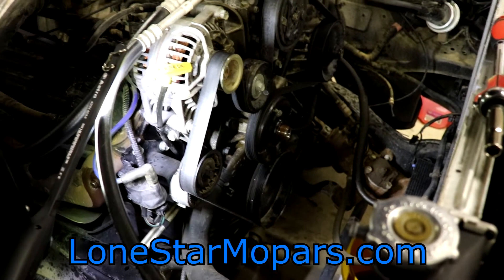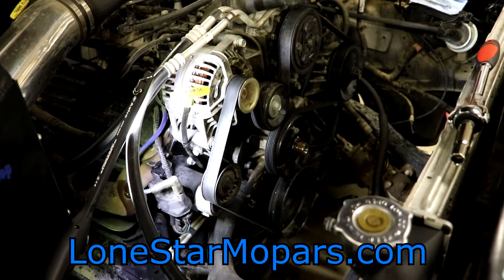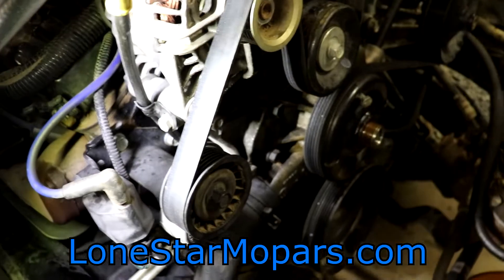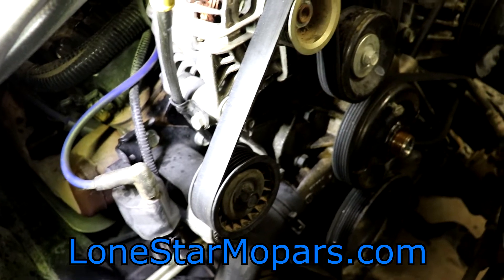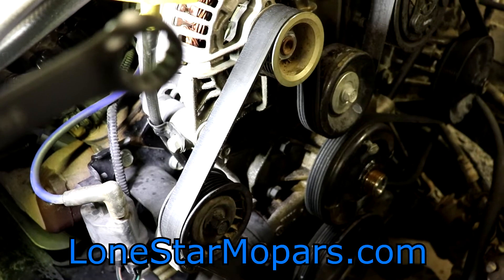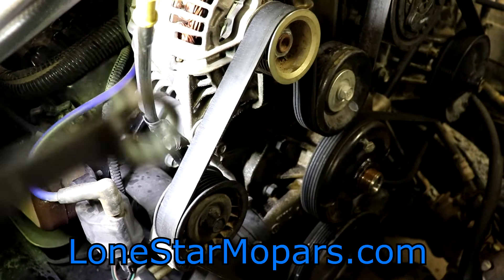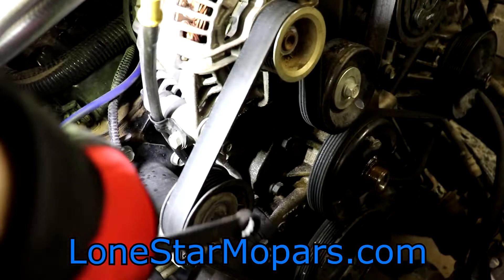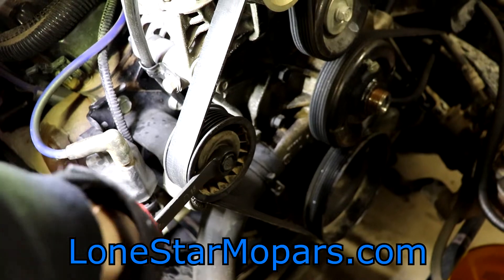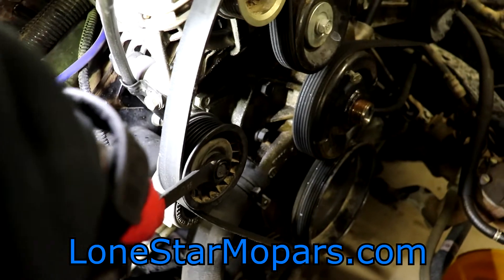Kind of exciting if you're super into it like I am. You can see the front of the engine in all its glory. We'll clean all this up shortly and I'll showcase the water pump trick. With the clutch fan off we've lost our turning point. We need to remove the serpentine belt anyway to access a lot of the other stuff back here. This is the idler pulley — it's going to be 15-millimeter.